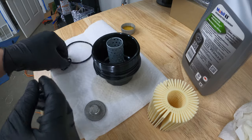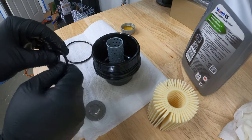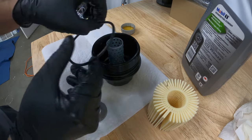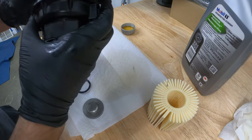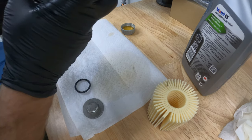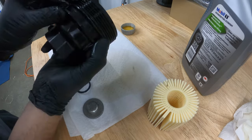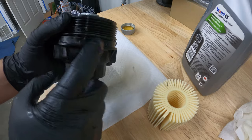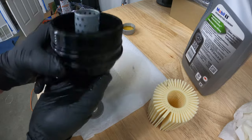Now you're going to take your new o-rings, and I've got a little bit of new oil — I'm going to dab it on my finger and go around the new o-ring. This way it's lubed up a little bit, which makes it slide onto the housing better and makes a better seal once you put it back on the car. Do that to both o-rings. Then take the o-ring and place it over the housing and slide it down — you don't take it all the way to the bottom, you put it one notch up from the bottom, just like that.